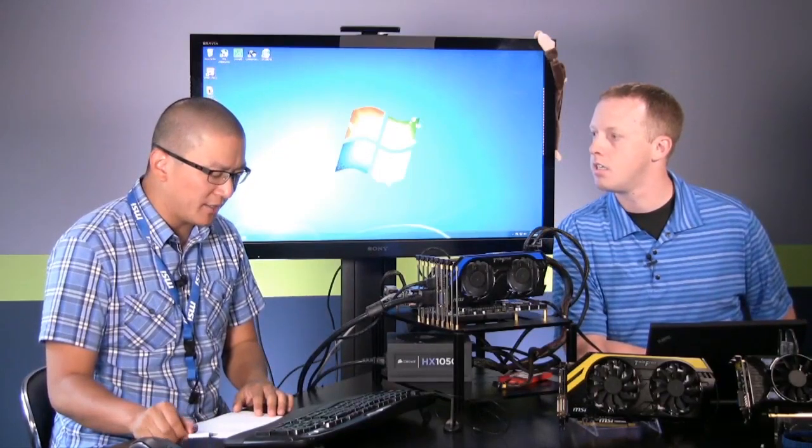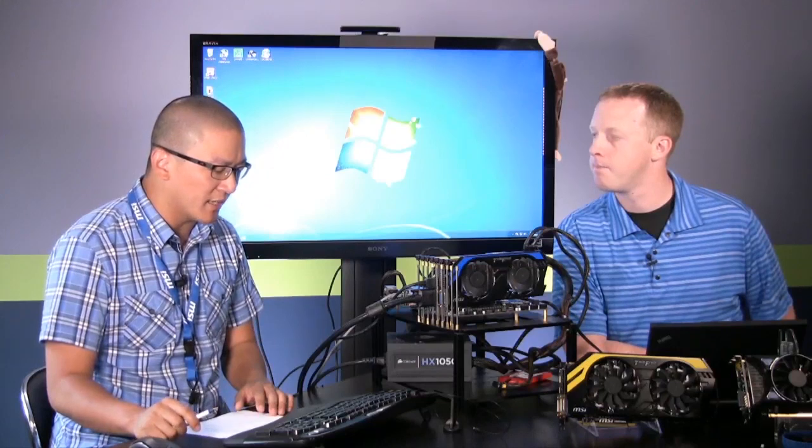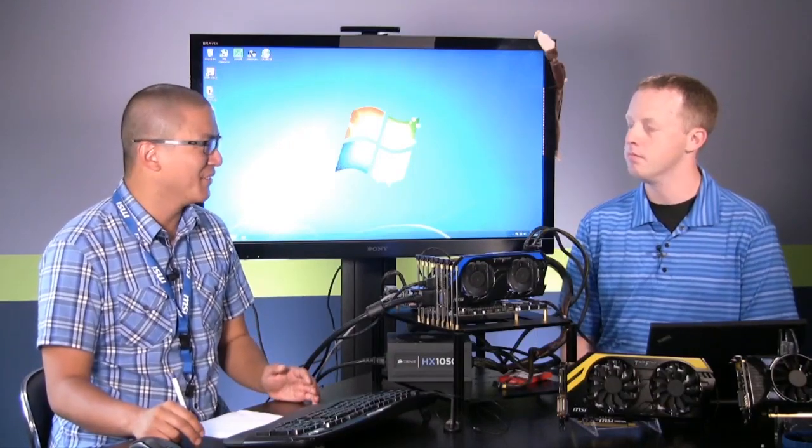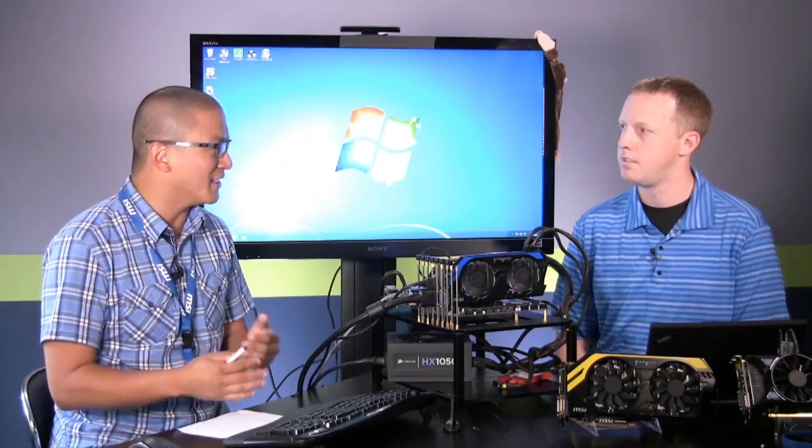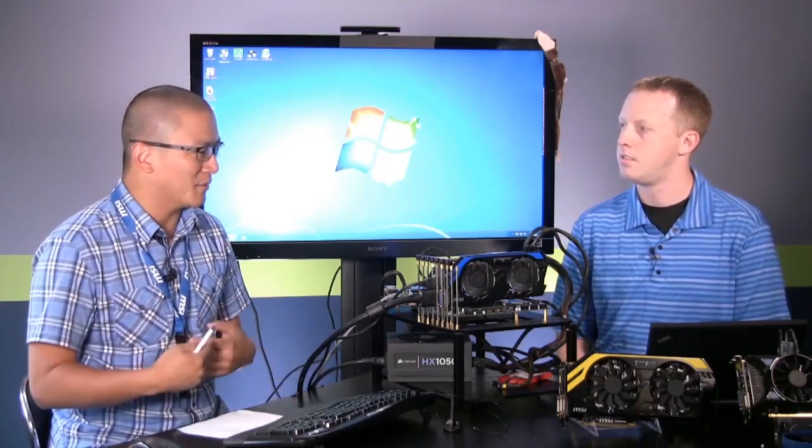We can't. It could be made available, but the problem here is that we can't guarantee that you can replicate that result. If, for example, you have a dud of a CPU, it's perfectly fine as far as Intel is concerned, but it can't go past, let's say, 4.3, which is a fairly low overclock. If it can't go past 4.3 stable, then you can't replicate this scenario. As a result, we can make this profile available to you, but if your CPU can't do that, then it becomes a problem for us. We would basically promise but not deliver.